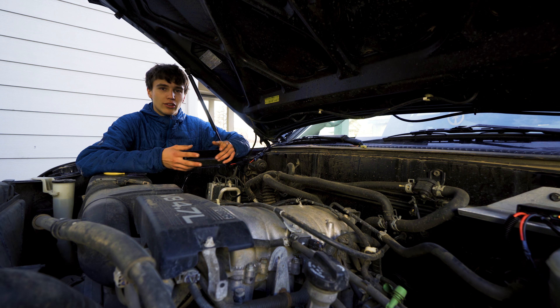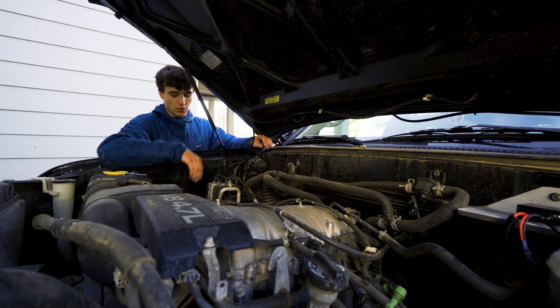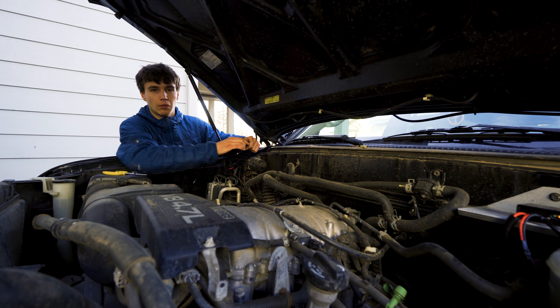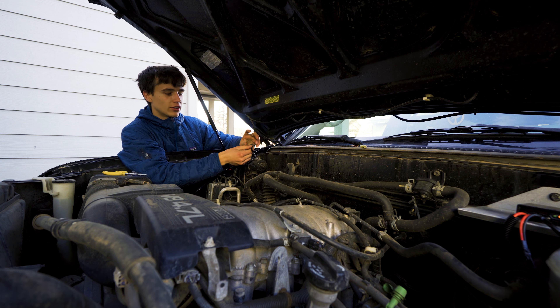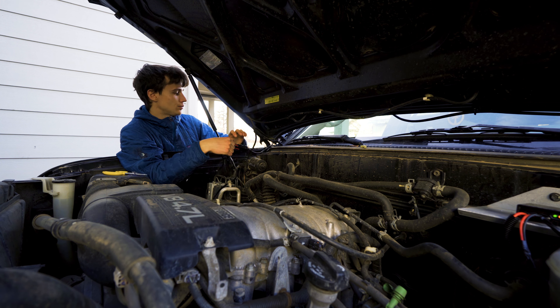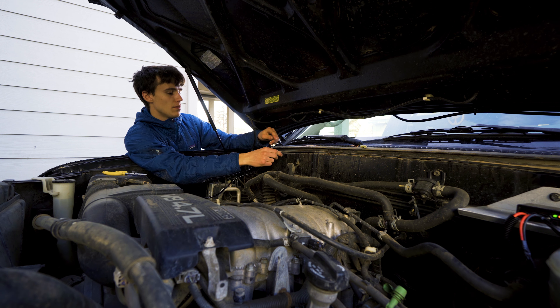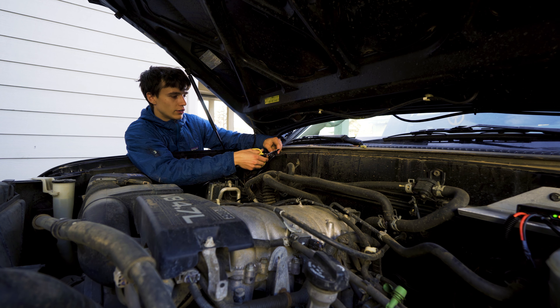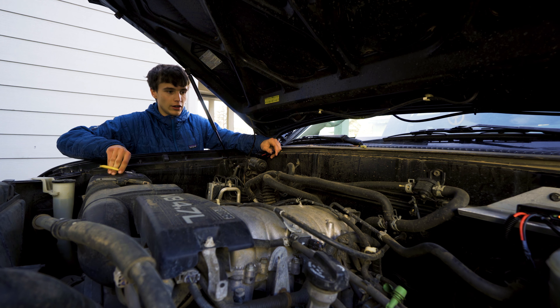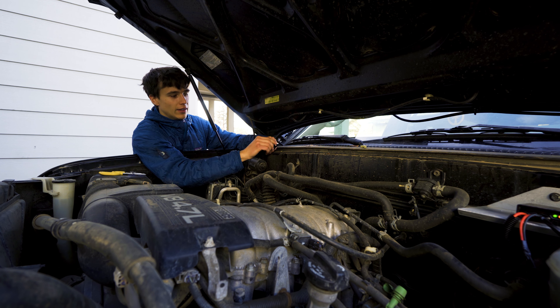I'm just getting all of the pieces ready. We're going to connect in the Auxbeam wiring harness just for this connector, so that if I ever need to replace a ditch light, I have this easy connection in my wiring harness. With both of these connected, we're going to cut both of these wires. Right now we have two positives and two negatives — we're just going to solder these together so that coming out the other side there's just one positive wire and one negative wire.